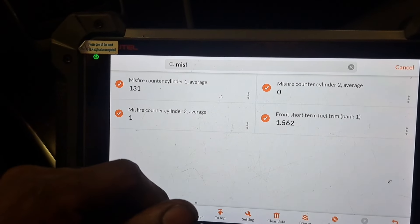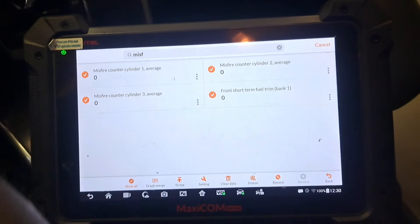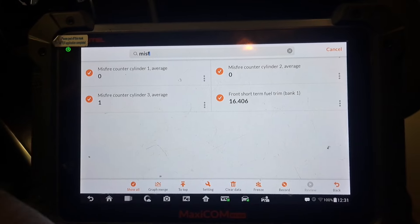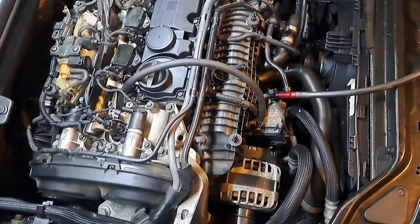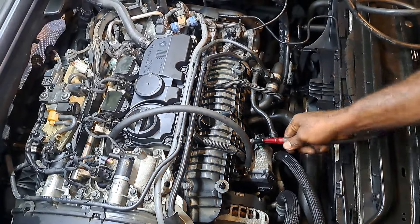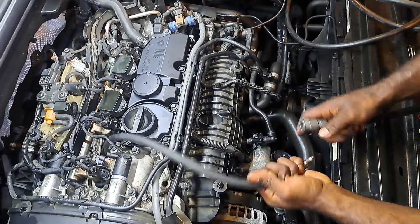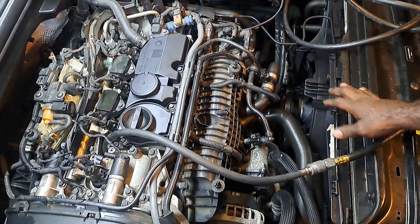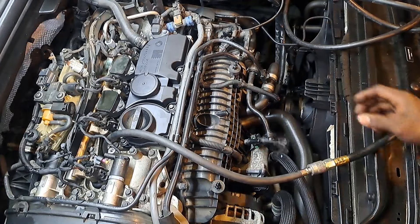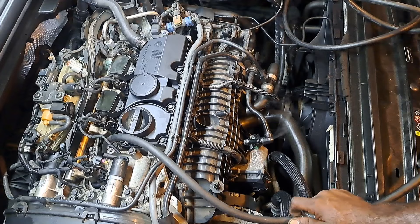I'm going to let it warm up to about 130 degrees, then do the same test. Right now I can shut it down and start it back up and it's not going to misfire. So I can run out there, pull the plug, and do the same test. It's not as bad as it was before — before it just shot out like crazy, now it's more of a trickle. We're just going to have some valve problems. That's all that is.